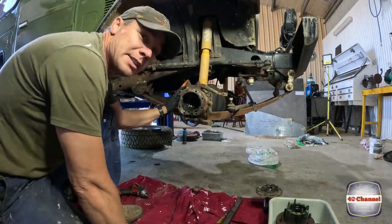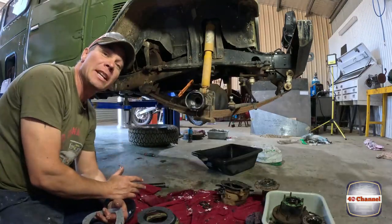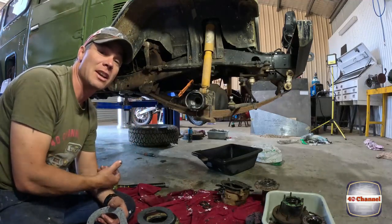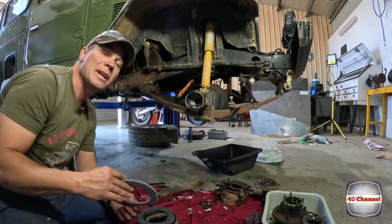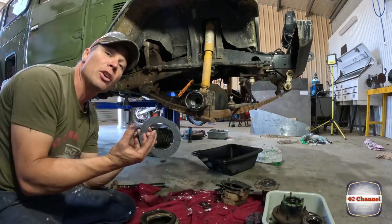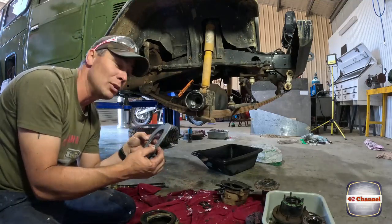I'll remove all this hub assembly, and once we've got it all apart we'll show you how we put all the front disc brakes on. Take this opportunity — if the bearings aren't new, now my bearings are like 5,000 km old so pretty much brand new, just cleaned it all up. You might want to go and put new felt and all those bits and pieces on it. If you get your felt, soak it in your Molletac grease, just work it right in all around that felt so that felt now becomes waterproof and it's full of grease.